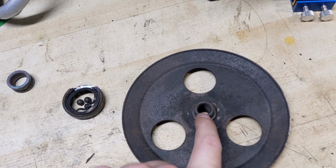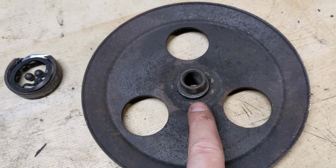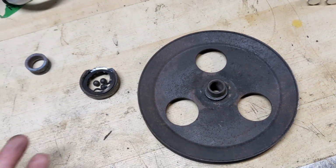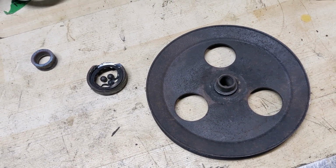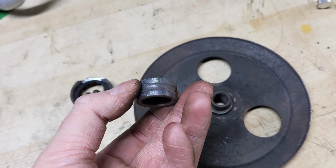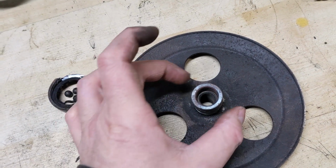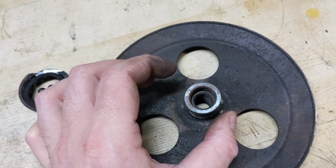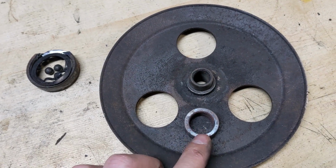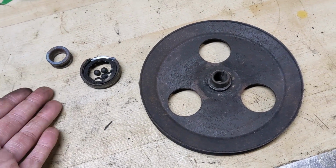because if we used a torch, again, the flames from the torch are going to be deflecting off of whatever it is that you're heating, and we would have been putting quite a bit of heat to the pulley. Again, that's the whole point behind induction heating technology: if you have something like a bearing's inner race that's seized to something like the pulley, when you're using that induction heat, it is heating this up first, and the heat goes to that faster than it does to the inside object, obviously expanding that.